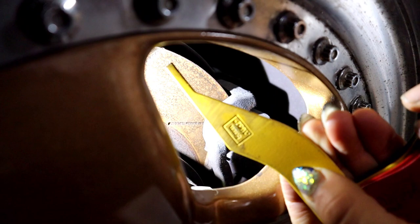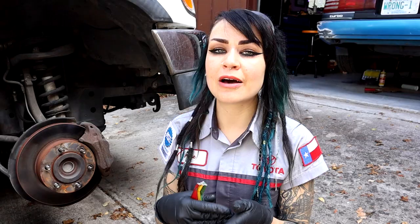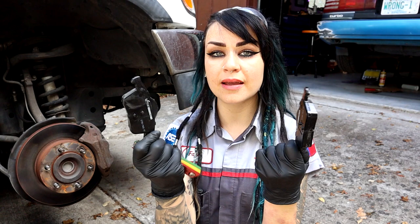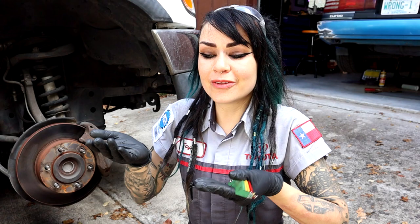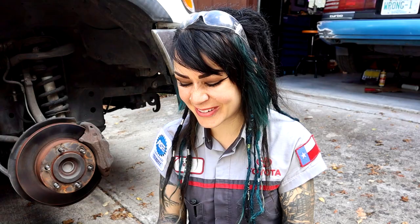You always want to measure both the outside and the inside pad, because if the inside and outside pad thickness differ by a couple millimeters or more, that can indicate more problems than just worn brake pads — maybe a sticking caliper or sticking caliper sliders. It's really good to measure all four pads for a proper assessment of your front disc brakes. We're talking about disc brakes here, not drum brakes — shoes have a totally different measurement and the green/yellow/red on this gauge won't be accurate for shoes.